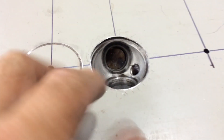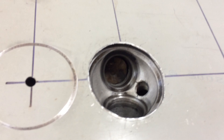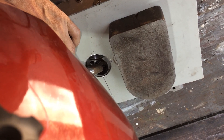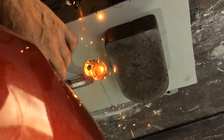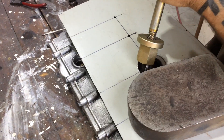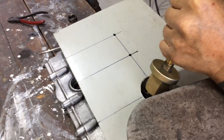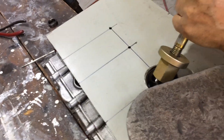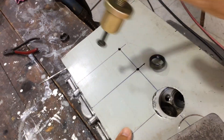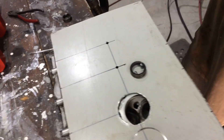That one comes straight out — worked good. I put a little piece of metal in there to protect the valve guide. I've just got that on there to protect it. I'll just weld a little blob here. There's one, this is the other side. So I'll have to get you to help hold that a bit. Is it coming? I wouldn't say it was easy, but it's coming. There — got it. Good trick.